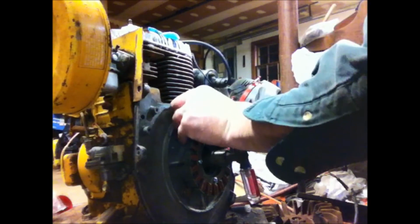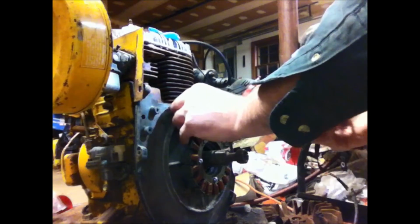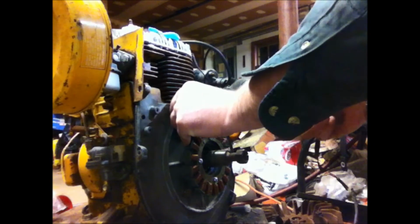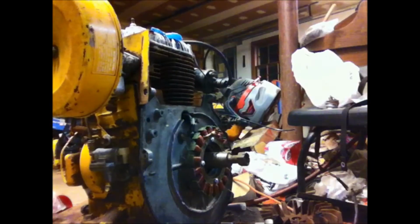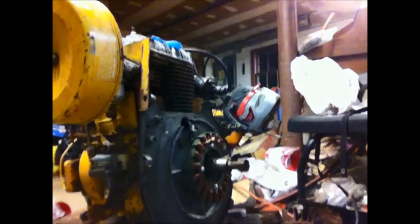This here happened to be out of a Case tractor, but again, if you look at the old Kohler parts book, if you have access to that, it's a PDF file. I originally downloaded mine directly from the Kohler website. Of course, the screw is a different thread. But that told me what engines use this, what spec numbers, etc. And you can look, and there's only like 3 different types of alternators, so you've got a pretty good chance of getting the right one. But that's about it.